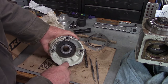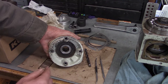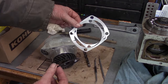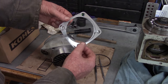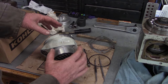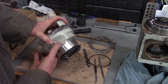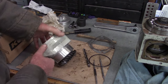I've been carefully cleaning this housing and you want to get all the cleaning done while the seal is still in there, because it's protecting the bearing from any dirt. Your main tools are going to be dental tools — scrape all that stuff out. Be sure to get in and clean the splines because there's always some loctite that gets down in those splines. I also took out our o-ring and our shims. If you have a thick one and a thin one — as is the case here — always put the thin one against the housing when you put it back together, so the thick one protects the thinner shim. Shims go on first, then the o-ring.